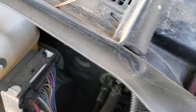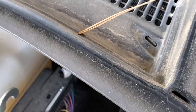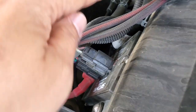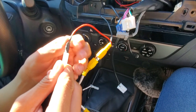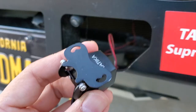I'm running the wiring harness wire all the way through the side and coming down — I've got a bunch of other wires coming through here too. Everything is going down underneath and then all the way inside. Route the wire where you need it, nice and clean as possible. On the inside all you need is the RCA cable and the power cable, as I showed in part one.